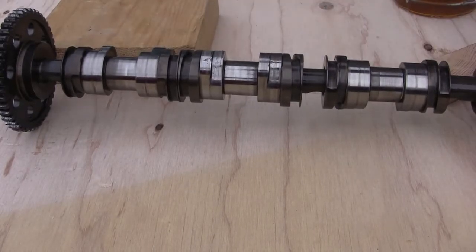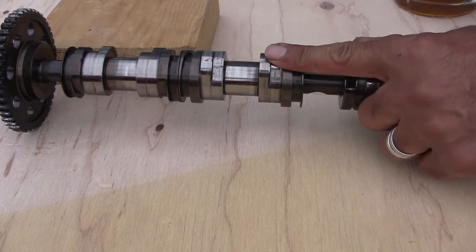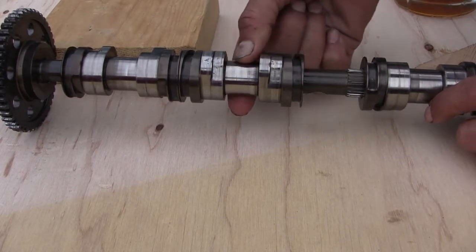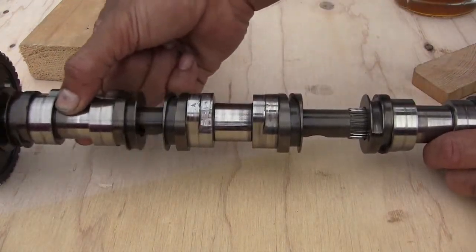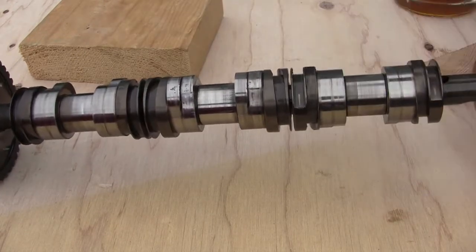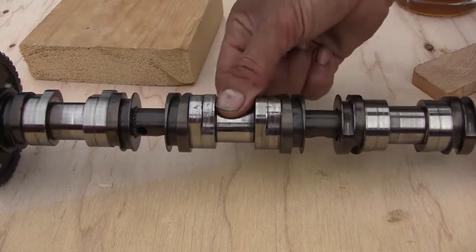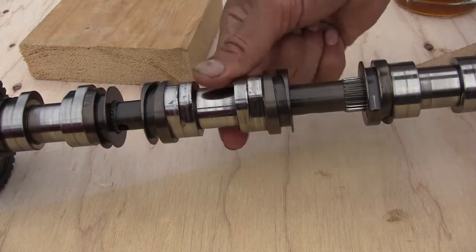I found out what was causing the misfire. When I first removed the cylinder head cover, I found that this cam lobe was sliding freely — just sliding like this. The fourth one was the same way. Numbers one, two, and three were fixed, just like they should be.